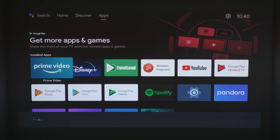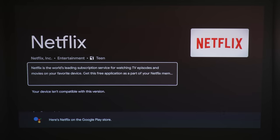How do I know it's the projector and not the dongle? Simple. I took the dongle out, plugged it into my TV, and installed Netflix no problem. When I plugged it back into the projector, it wasn't there anymore. When you go to the Netflix download page while on the projector, you get a message saying your device isn't compatible with this version. I asked BenQ about this eight or nine months ago and they said they're working on getting Netflix supported, but I guess it'll never come. I plan on buying another Apple TV to stick above the projector and just use that. If you plan on using something other than the included Android TV stick, you can use the exposed HDMI port or the one where the dongle goes in.